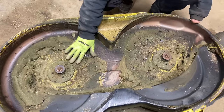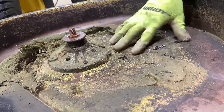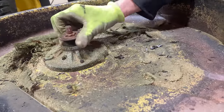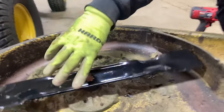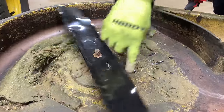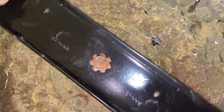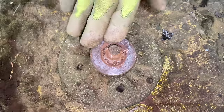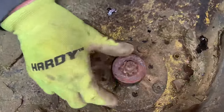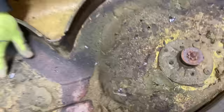It's not pretty, but the first thing you got to do is figure out which side is bent. I can tell by looking at this that this one is leaning down, and that blade was leaning down. Before you go ahead and straighten the deck out, you want to check to make sure that your blade spindle is not bent. You can check it by spinning your blade and taking a look at the center of the shaft to make sure it's not bent. You don't have to have the blade on there — you want to make sure that your spindle is not bent. You can bend your spindles — the shaft right here, the spindle shaft — so just spin them and make sure they're not bent or wobbling. So we know that these are straight and we still have a bent deck.